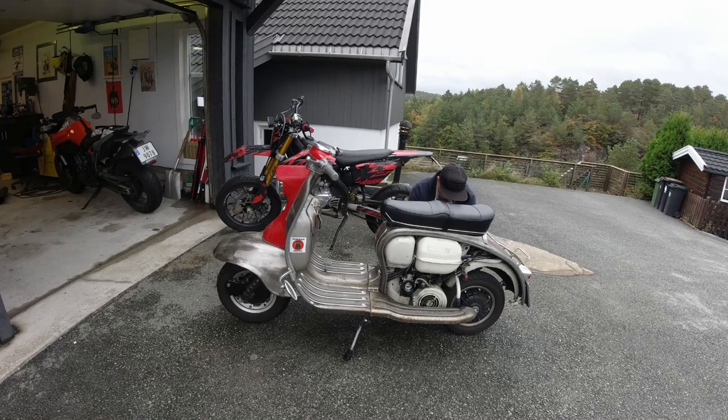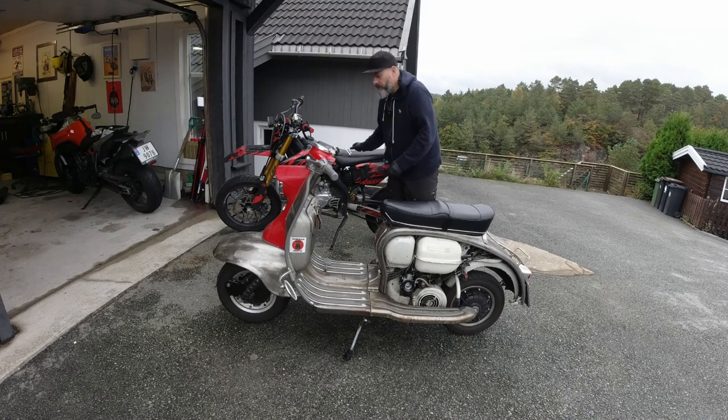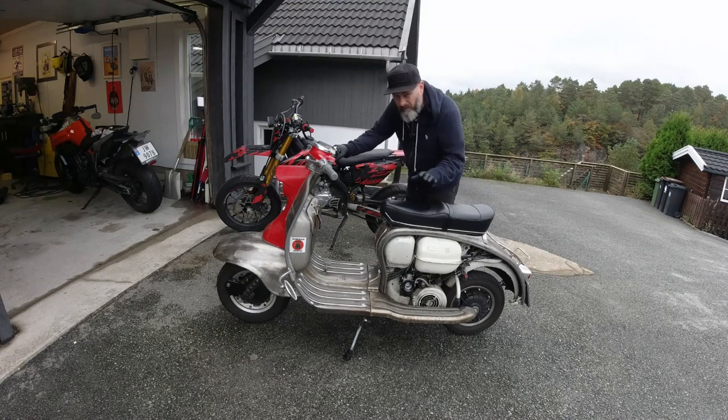One thing I can see while I'm down here now is that I have got a very, very close to 90 degree angle on the clutch arm that's on the engine case here and on the wire there. So that's why I've got such a nice light clutch, even though this is, as you know, a LTH7 plate clutch. So we'll give that another go, just to make sure that I'm in the right ballpark.